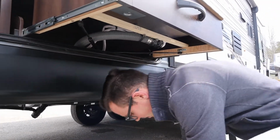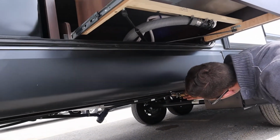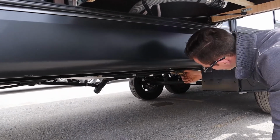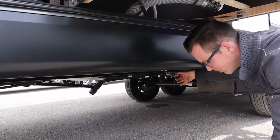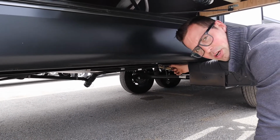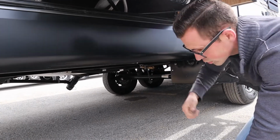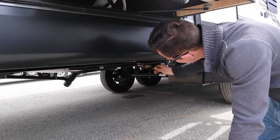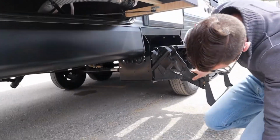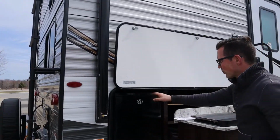This is just like an air fitting. There's a valve here as well, behind. You have to have the valve off, so against the line, to hook up this valve. If you have it on like that, it won't let you compress the sleeve. So have it off, hook up your hose, and you're good to go for your outside kitchen. For travel, leave this plug in there, protecting your gas line. And then our fridge is nice and easy, just an electric fridge.